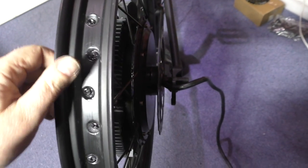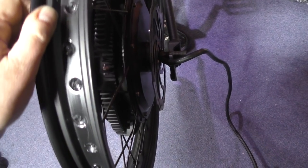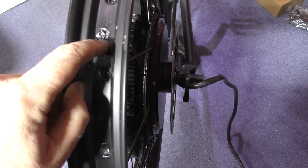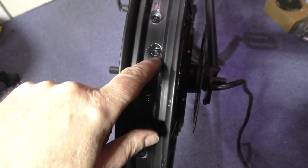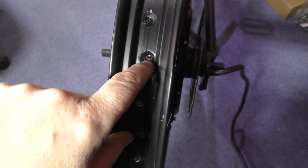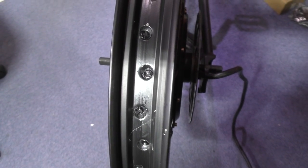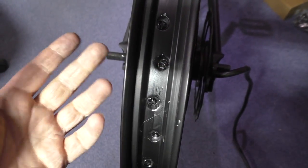When you're lacing these wheels up, especially the back wheel, because these are 10 gauge spokes, grease the nipple. Make sure you've got greased nipples. Oh god, I'm so juvenile. Yeah, make sure you use, this is a graphite grease, I think, I don't know, it was just grease that I had. Grease the thread and also grease around the, I can't make this sound bloody non-suggestive. Grease everywhere, that'll do.